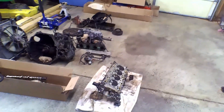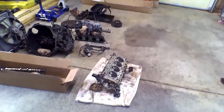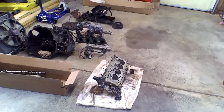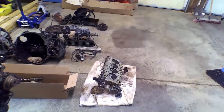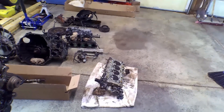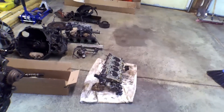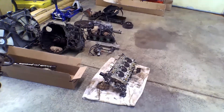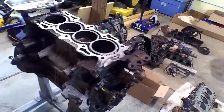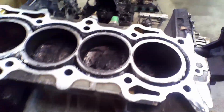When I started, I noticed I was having a problem with this car — it began with it using water. I'd have to put water in it about once a week. Then over the summer it started to blow through the radiator overflow; parking it, it would just be hissing. I knew these were probably symptoms of a blown head gasket. So what I've done is take the engine out of the car — not just for the head gasket, there are some other things going on with it as well. I got it on the stand and started tearing it down, which went pretty smooth.